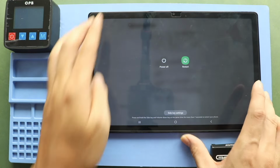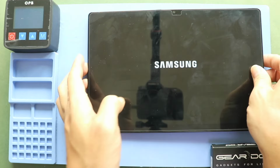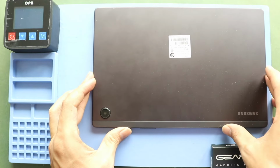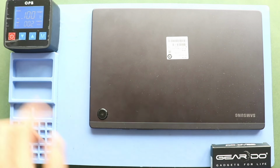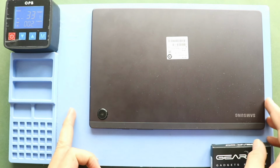Today we will show you how to replace the charging port board of the Samsung Galaxy Tab A8 10.5 X200 X205 2021 models. To start, we need the right tools to proceed with the repair, which you can find in the description. First, turn off the tablet and remove the LCD screen from the front.